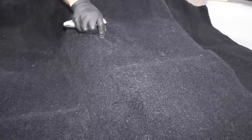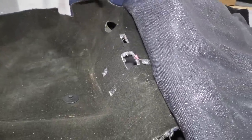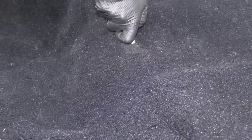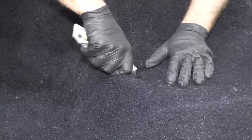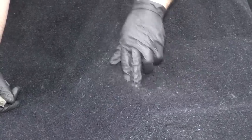For this vehicle, it has the shift lever for the four wheel drive. That hole is critical, so underneath here — fold this back — you can see this hole; that's the one I want to cut before anything. If I cut that first, then when I go to install it in the car, it can go over the lever. Everything else I'll cut out in the car. Make sure that's pushed down — right there is where I want to cut. I'm going to cut a slit down the middle like that. The carpet is a lot easier to cut than the insulation. Slice like that, and I can trim it up better once it's in the car.